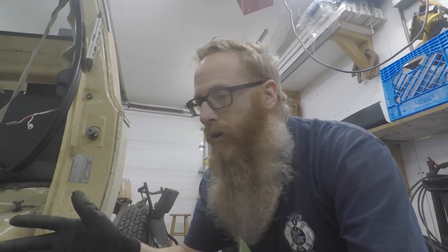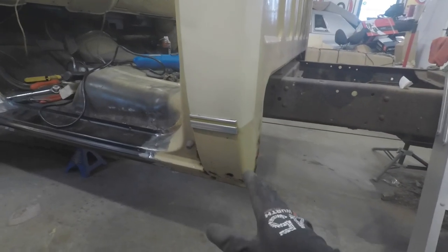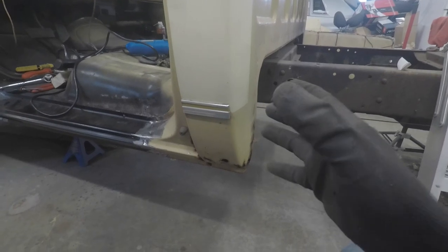All right, so we managed to get the inner rocker panel all welded in there. We had it probably about 3/4 in place before I realized I didn't have the gas onto the MIG welder. So we cranked the gas up, we went back over a few spots and made sure that everything was well attached. Now it's time we tackle the final leg of this whole welding journey.